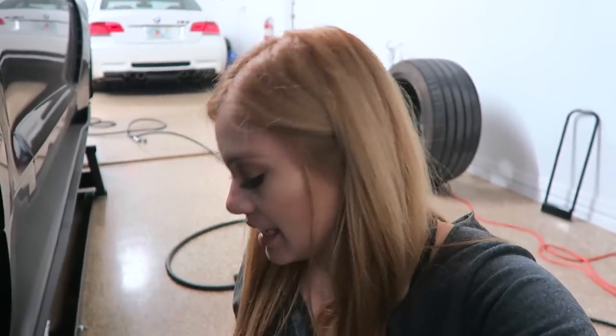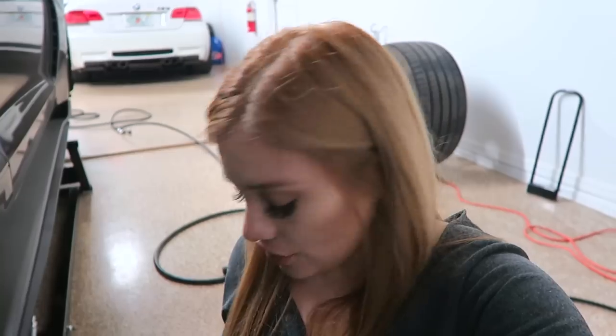So I have some documentation and it calls to start off with the right rear side first. I'll be starting off with the inner bleeder and then just work my way out to the outer bleeder. Once I'm done with this side, then I'll move to the left rear side and I'll be using this 11 millimeter line wrench and also this 11 millimeter shorty wrench.